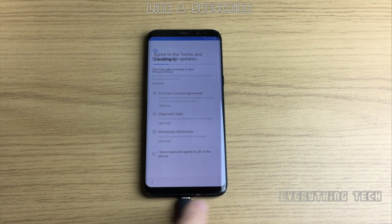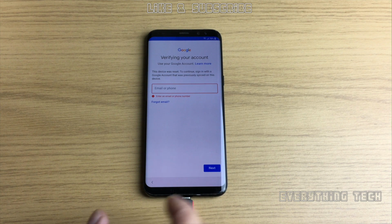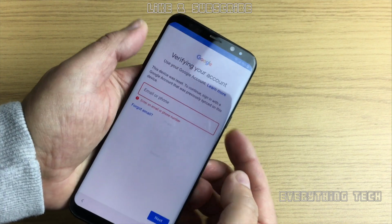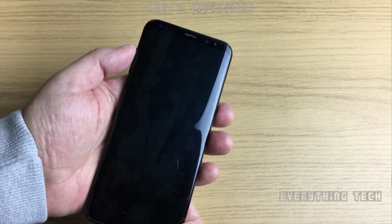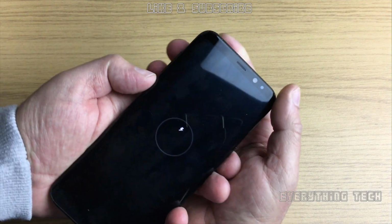G955F. All the links are going to be in the description, and this works for up to binary 4, U4 or S4. So as you can see, I'm showing you that the phone is indeed locked by FRP, and now we're going to go and check what firmware is in the device. This works with firmware 1, U1, S1, U2, S2, U3, S3 and U4, S4. It works with all these firmwares, but all you need to do if you're on a lower firmware is update the phone with the full firmware that I provided in the description, and then you can follow the guide from the beginning.